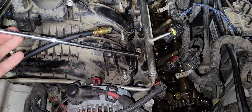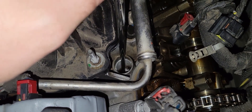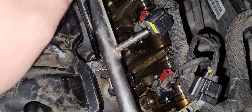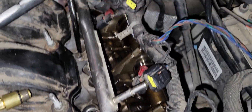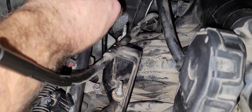This is just a telescoping magnet with the magnet missing. You can get down there and you can tell that it's at top dead center, as opposed to a different valve next to it. Like cylinder 6 goes way down there — so you can tell the difference.